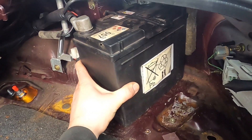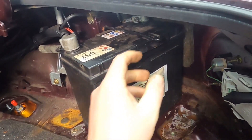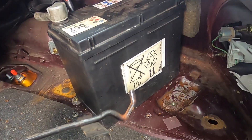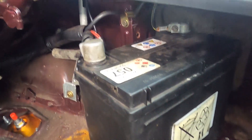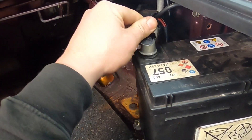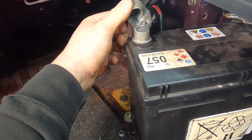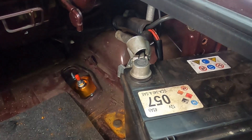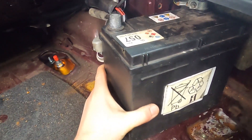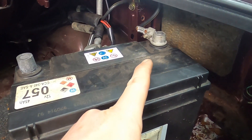You should then be able to slide the battery out slightly and remove the top tie-down — there's a little hook that goes into the chassis back there. Now disconnect the terminals. Disconnect the positive first, then slide the battery out further to gain access to the negative.